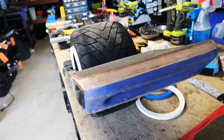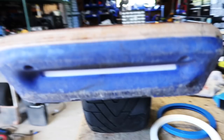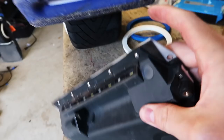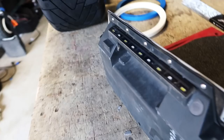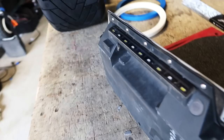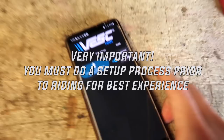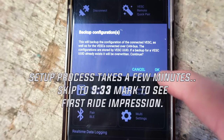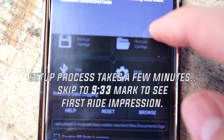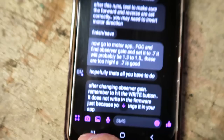Fully assembled, we're about to turn it on. However, before the moment of truth, I realized that there are no headlights for VESC as of now — there is no current slot or mold in this prototype VESC cover. Something to keep in mind; I'm sure that's easily fixable down the road. Alright, we have live — put in a stock battery. Now we are going to connect to the VESC app. Back up motor and app configs. Backup successful. Then run Motor Detection Wizard setup. You can invert motor direction.